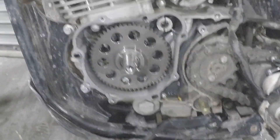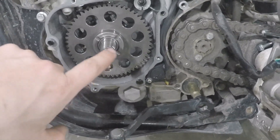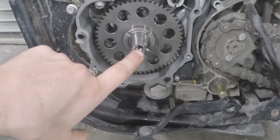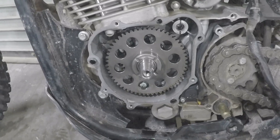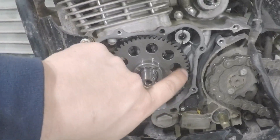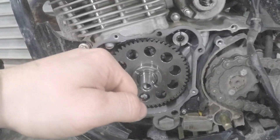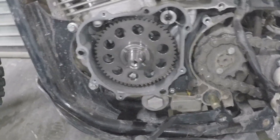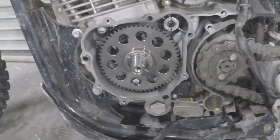Now the steps going back together are just everything you did taking it apart. I believe — and I'll double check — the crank nut, the keeper bolt for the flywheel, is 53 foot pounds. Joe mentioned that, so I'll throw it in the description below. All the small bolts going around are usually about 10 foot pounds — you can do those just hand-tight with a little snug; you don't want to go crazy tight and snap them off in your motor, and then you're not having a good day. Let's go ahead and get this thing back together and get it fired up.